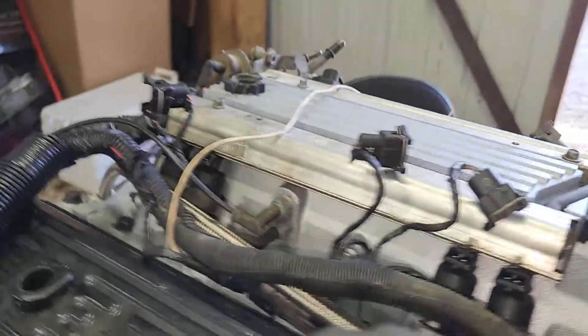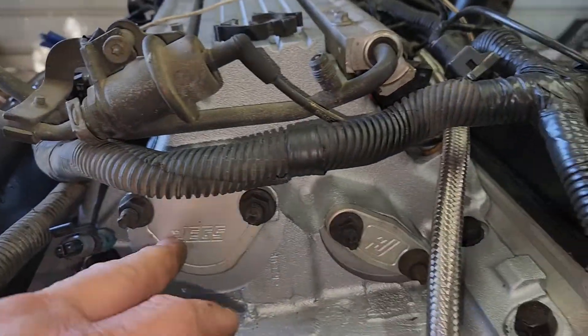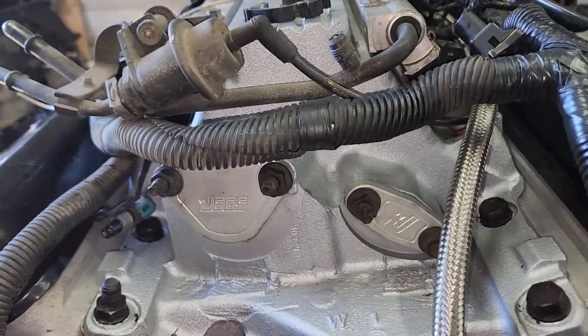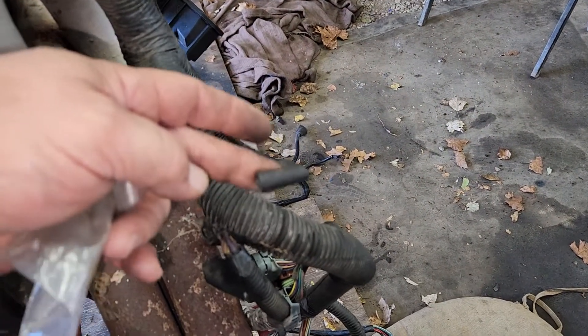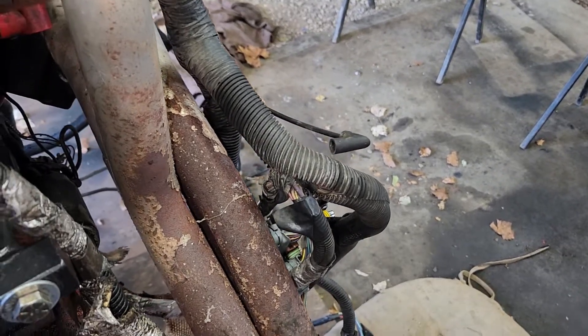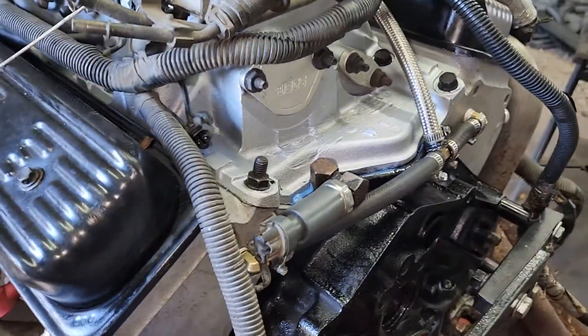Now we'll come back around here since we got all the important stuff on that side. And on this side you usually have an EGR - we've unplugged that, we're not using any of that. You do have a vacuum line that runs from your fuel pressure regulator over to this port. The bottom port I put it on. And then this top port goes back into your wiring harness, which comes out over here and connects over by the computer for your HVAC for your vents. That's what changes the vents - your vents work on vacuum when you change it to defroster or for it to come out the feet, etc.